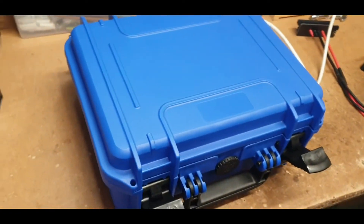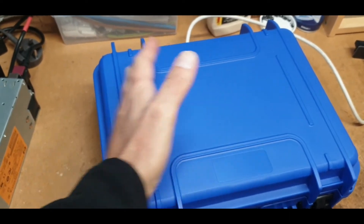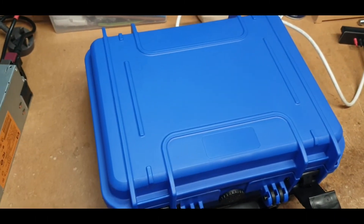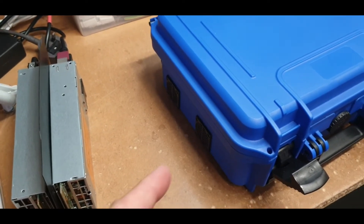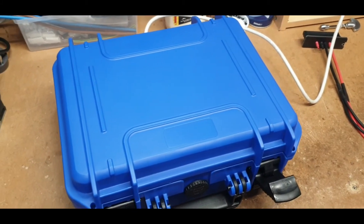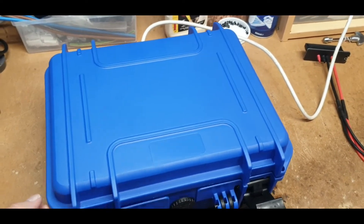I'll add some photos so you can see the innards of that layout, but it works really well. That fixed the only real issue — the exhaust side of the fans and PSUs was throwing warm air under the deck, making that side a little warmer to the touch. Not excessive, but we don't want any heat kept within the case. With those ducts in place, the PSUs just suck the mildly warmed air out of the case and expel it to atmosphere. Feedback from Sean confirmed: perfect, that's fixed the issue. He had a 3D printer, so I just sent him the STL files, he printed and mounted them after drilling a hole. I've implemented that solution on this build as well.